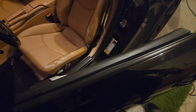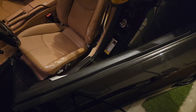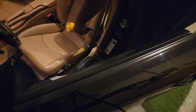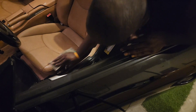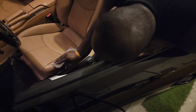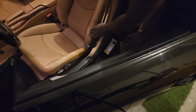Now I've been giving it some time to cure, but I can speed it up with the blow dryer or with the heat gun on a low setting, so that we can get this hardened up and sand it. Now I'm sanding down some of the filler and I'm using a thousand grit. It was saying I could do 600, but I just had a thousand around, so I'm just going to take a little more time and sand it. I'll have probably a better finish — it won't be as rough. You can see some of these areas starting to blend down.